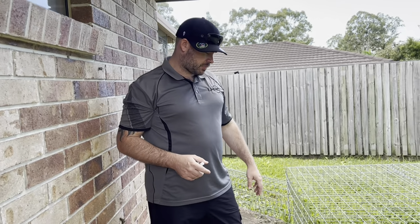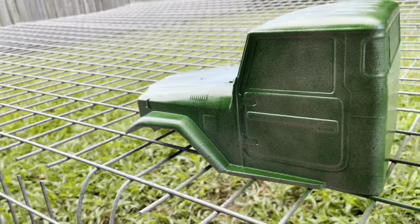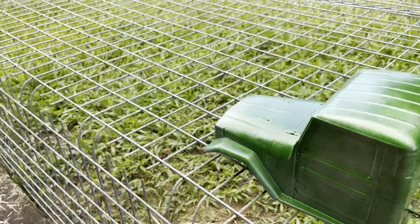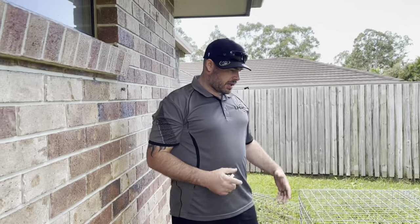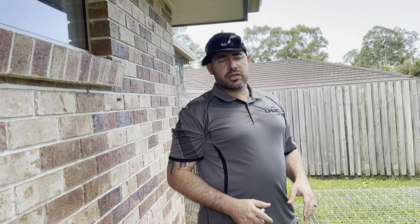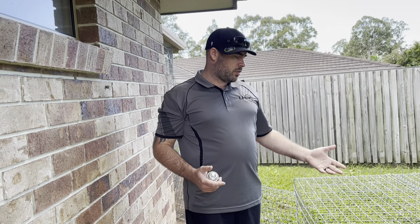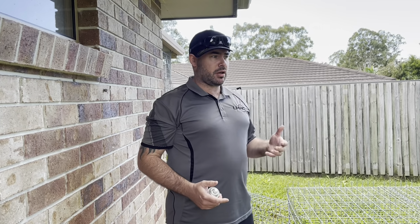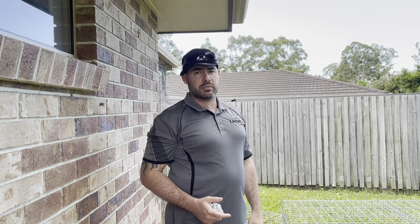So definitely the next process is where I find the most fun, when you really watch it start to take shape. You can see with the paint job, again, it is the dust coat, and that's why it's partially silver and green. Because it's about to go under heat lamps, we are getting some gray clouds over the top. So we're not gonna rush it. If we need to call it a day, we'll call it a day. But with so much paint going on in the last hour onto this car, it's almost the same, if not double the cure time. So if it goes on for an hour, then it sits for 2 hours before we work with it.